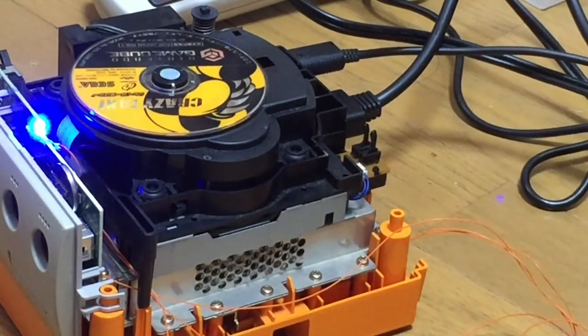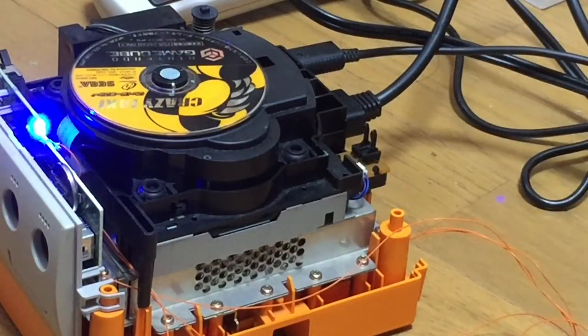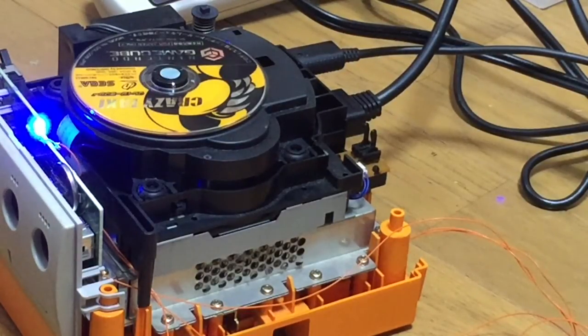Just a couple of anodes, couple of cables. Cathode is soldered into the board, and then just take the positive away onto the middle of the switch. Then the two cables back to each anode. So really straightforward. And this is after, if you followed the region mod, then you would have had the switch ready and it would have all been prepared. So hopefully that's been helpful, and some of you, or at least one of you, is attempting to do this yourself. So thanks for watching, and good luck.